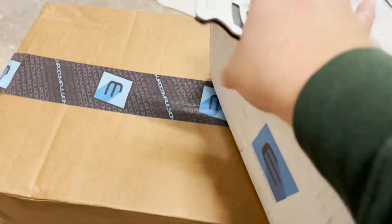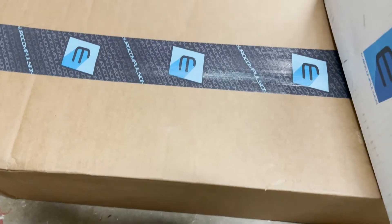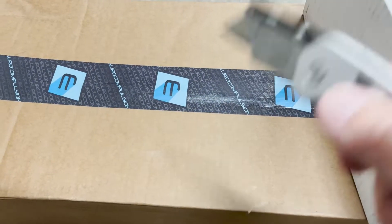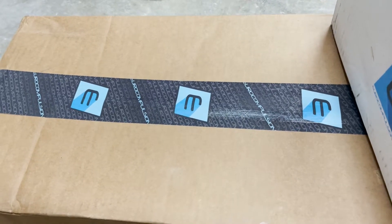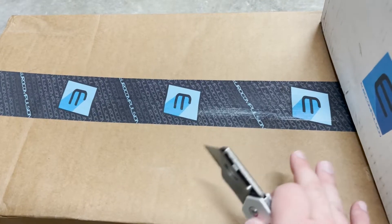I told them I want to do a little bit more than just Stage 1, so in this second box is the crossover pipe for the exhaust, which should give us another 5 to 10 horsepower — hopefully about 50 horsepower to the wheels more than stock. That'll put us around the 180 horsepower range. In order to figure out exactly how much we're gaining, I want to do a before and after dyno. Comment below if you want to see a before and after comparison. If not, we'll go ahead and just do an after dyno.